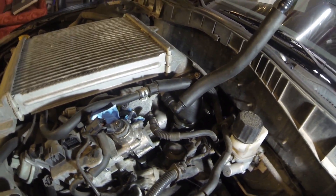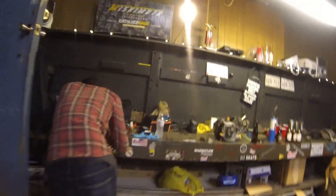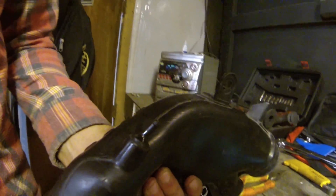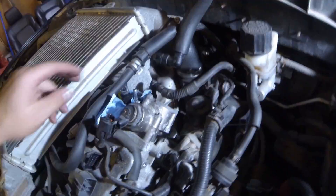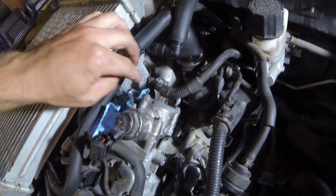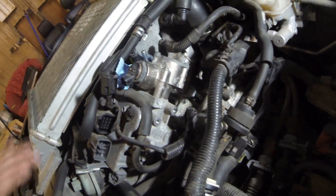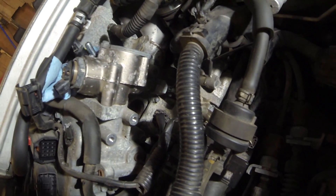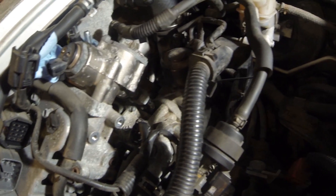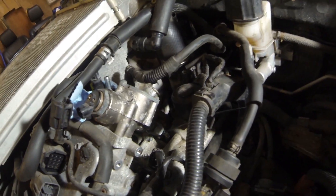The wiring harness is out of the way. We had a mishap with the intake — Kendra decided to break the nipple off it, and Spencer's giving it a glue job, so hopefully that works when it dries and it's strong enough to hold the hose back on. We've got one of our fuel lines disconnected — the yellow one — and there's still the blue one down there that has to be disconnected. Then that will be it for fuel lines, besides the drain, which is the steel line at the bottom. We've got to crack that nut, then take the three Torx bits off the fuel pump itself and it should come out — easier said than done.